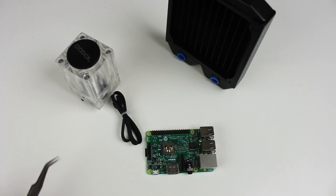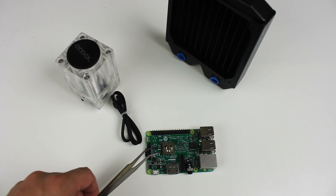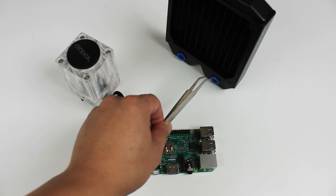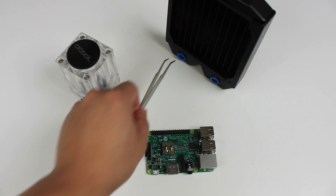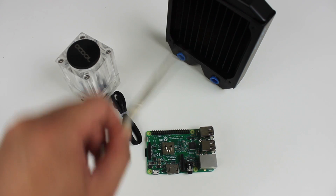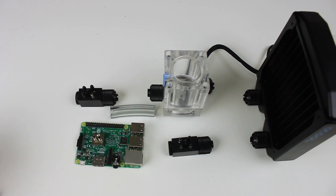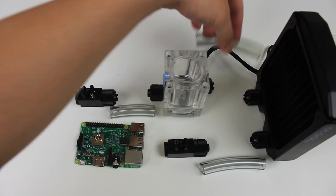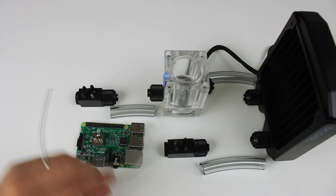So basically how a water cooling setup works: cool water comes from the reservoir, pumps it into the CPU, then it turns into hot water. The hot water then goes into a radiator, gets cooled off by the fins, and then the cool water goes right back into the reservoir completing its cycle. Always measure twice, cut once — right now I'm planning how I'm going to lay out my entire setup. I have all these pipes cut out and measured, all the tubing I need. Before I cue the music I just wanted to show you what I was doing.